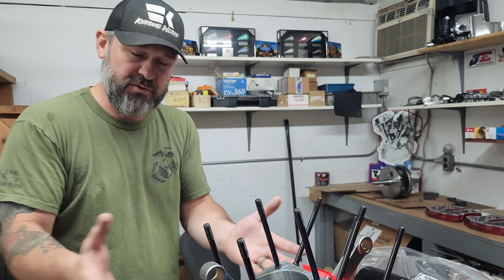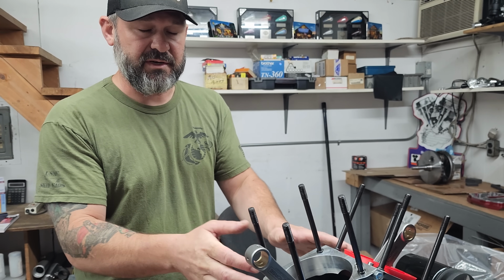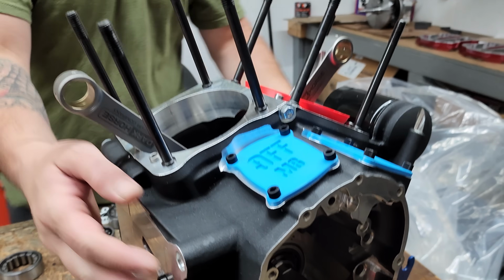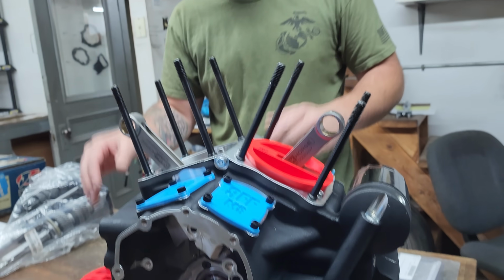You want it to be as strong as you can possibly make it. Do you have to balance these cranks here, or did Dark Horse take care of it for us, right from the factory? Because I know it's something you've done. You did that for my friend Jerry Rothman. He did his, and it was so awesome. These have a counterbalancer from the factory up front here. And so we removed it and balanced it.